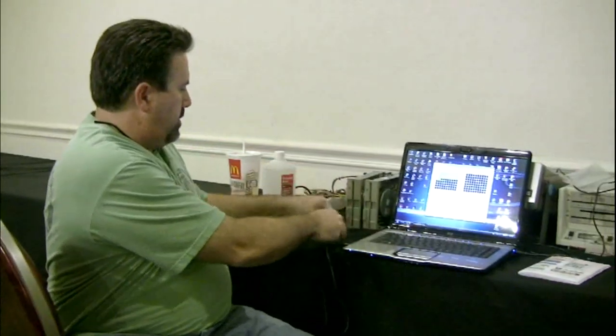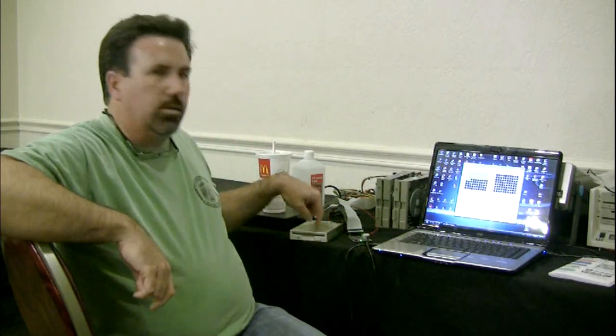Audience: For resurrecting Amiga disks and re-archiving onto a floppy, do you need an Amiga mechanism like a Chinon drive? No — just use any standard 3.5-inch PC floppy drive. And for Commodore disks, any 5.25-inch drive works. If you're going to be doing archiving of your collection, you'll want a good clean drive. One member buys drives off the internet, cleans them, puts them on an oscilloscope, aligns everything, and tests them. We use test programs as a benchmark — if it loads Bounty Bob Strikes Back and Rapidlok, it's probably good, since those were the really difficult ones for drive alignment.